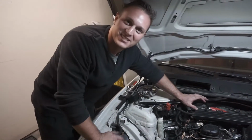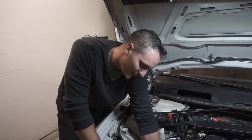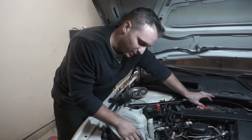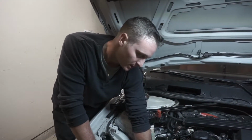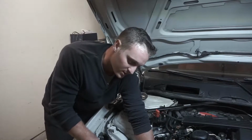I'm just praying that this is gonna go back together. So, we have both outlets kind of settled in here. What we're gonna do is start getting this front one on. I did use some Vaseline or silicone to hold the O-rings, because they are O-ring and V-band sealed.